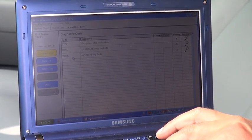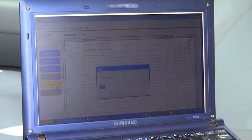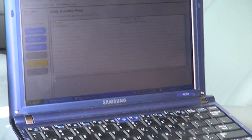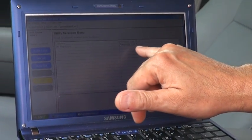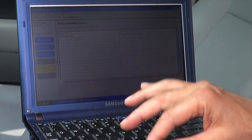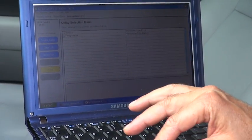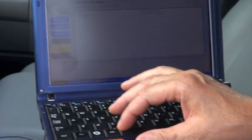I'm going to click on Utility. When it's done it gives me these options: Custom Immobilizer Code, Reset Transponder Code, or Key Registration. You can have up to four keys total. This is my last one that I'm programming right now, so I double-click on Key Registration.